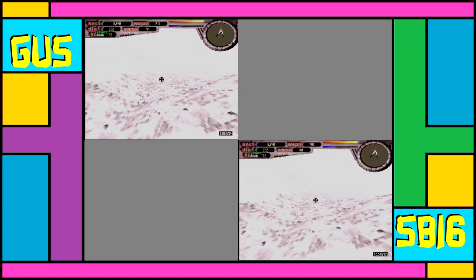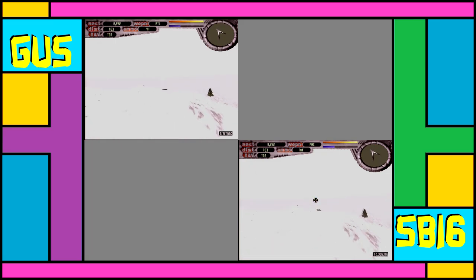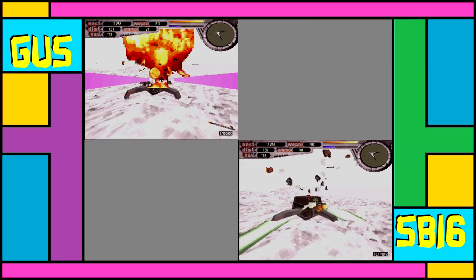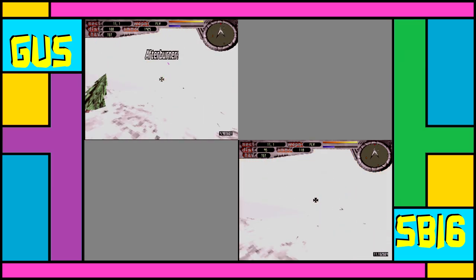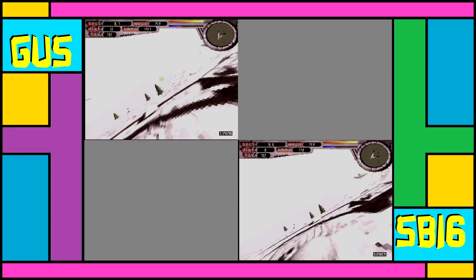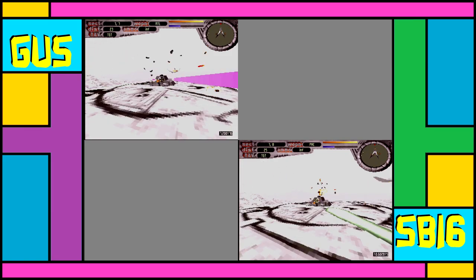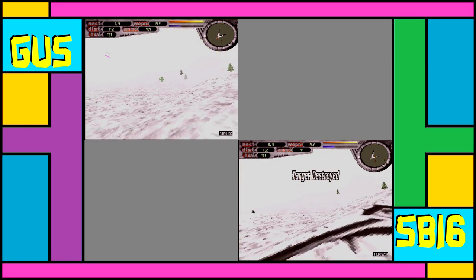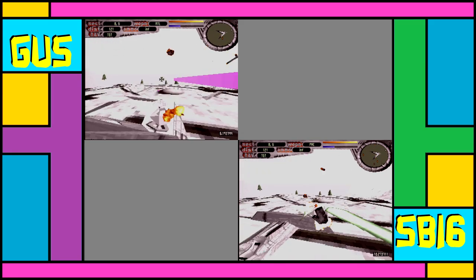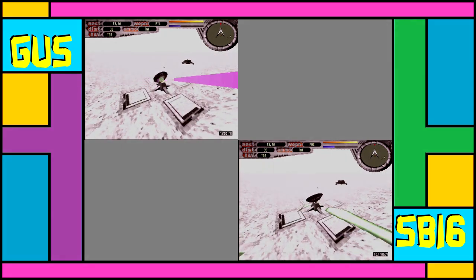Worse still, a good many games don't even seem to bother supporting the card properly. They seem to do things like mixing in software. Whether they do or not, things certainly perform worse, and I can see noticeably higher frame rate in many places when using a more conventional card like a Sound Blaster. And that's actually a shame, because whatever advantage the GF1 might offer by doing things in hardware has just been negated here, and the card's actually hurting performance rather than helping it. It kind of goes against the whole gimmick, really.